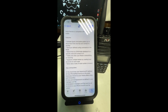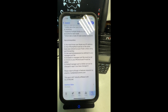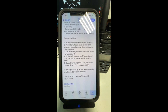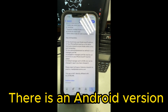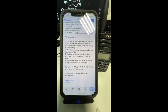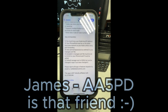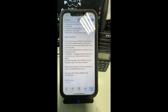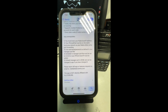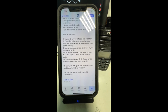There are some app prerequisites. You must know your node's local IP address. Your iPhone or iPad must be on the same local area network as your node, unless using port forwarding. And I believe there is also an Android version of this app — an Android user friend of mine is what turned me on to this. Nonetheless, you need to use the username and password as defined in your manager.conf file. Your bind address in manager.conf must be set to 0.0.0.0, or your phone's local IP must be added. The default manager port is 5038, but can be changed in the app if you have changed it — something to keep in mind, as a lot of people custom set that default manager port.